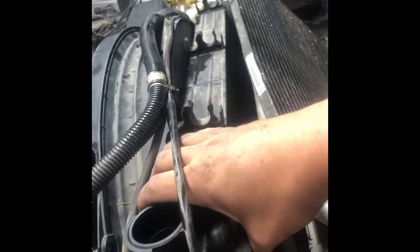I already have the nuts off the fan shroud. Hopefully I'll be able to pull this forward and pull up on the fan to release it from the radiator, so I don't have to take my fan off — I really want to avoid that. There's not much space back there. Next thing I'll do is the power steering cooler — there's a bolt here and a bolt on the opposite side. Undo those and it'll just hang down. Then this plastic piece will pull out at the same time.